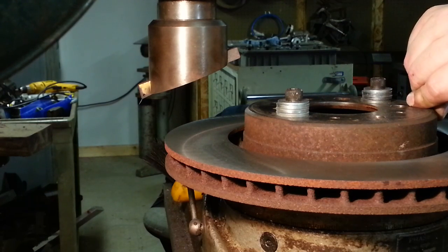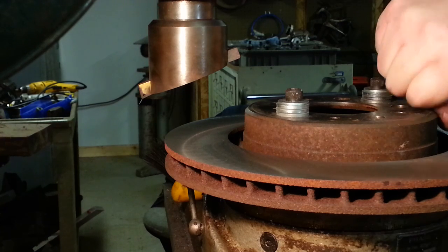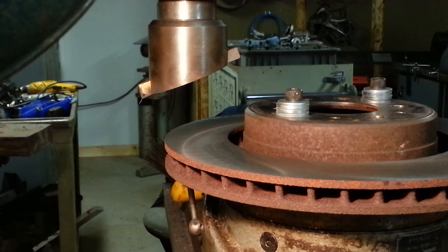It looks pretty even in thickness side to side in the center of the core there, because the core kind of moves around a little bit. I'm going to pull this off and try to find some marking that indicates minimum thickness, and then mic it. I'm not going to stick an indicator on it and all that, just because I'm confident that this side is parallel to the other side as good as I can get it with the tools I've got. Not much point in checking it, but it's a valid approach to fixing a problem when you've got a set of rotors that are warped.